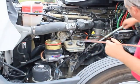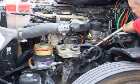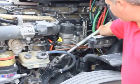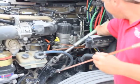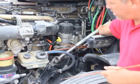My power steering shaft is properly mounted and secured. It's not bent, broken, or damaged. Not missing any bolts, nuts, or hardware. The U-joints are in place. And it has no excessive free play.